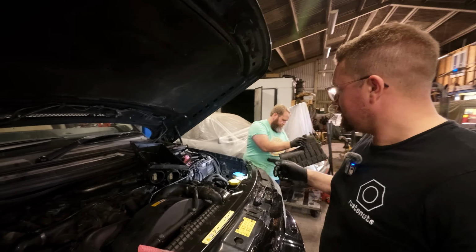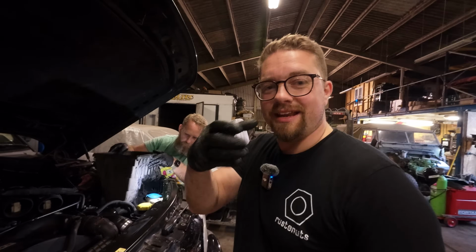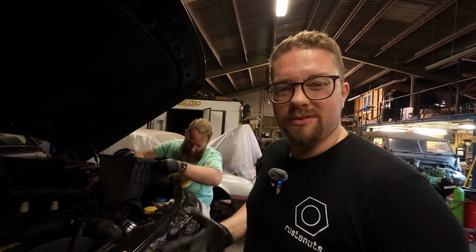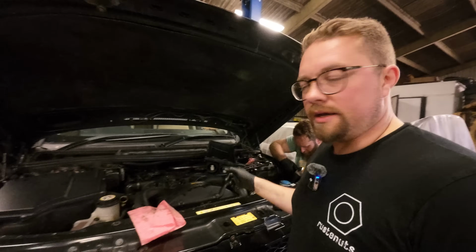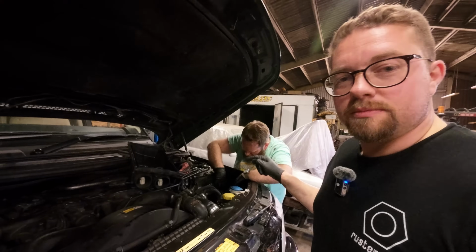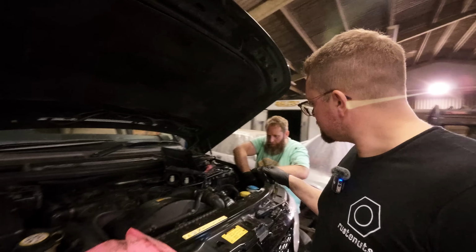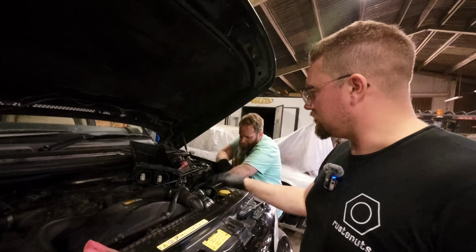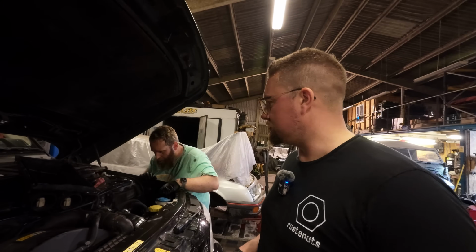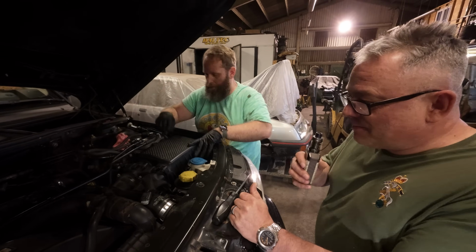Okay, so we got that back on. Liam took those two 10mm bolts out, and he could get his hands around the fuel filter and get that collar tightened, because that was the thing we were struggling with. We started it up, cycled the ignition a few times, all fires up fine, so that's good. Airbox goes back in now, put the air filter in, and then I think that's service done, right? Yep. Obviously we've got the pipes to do, but the core service items are all done, thanks to Liam's help. QC's here.